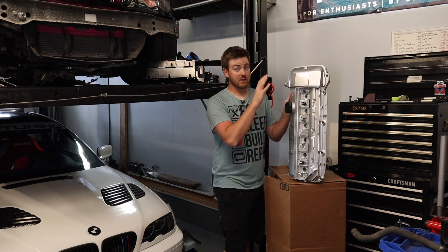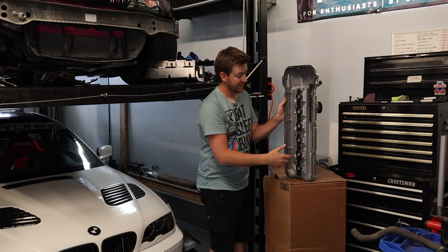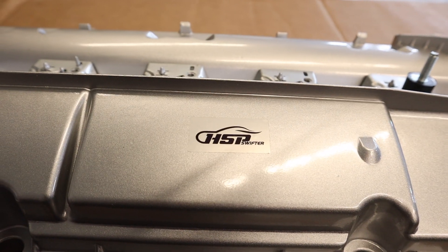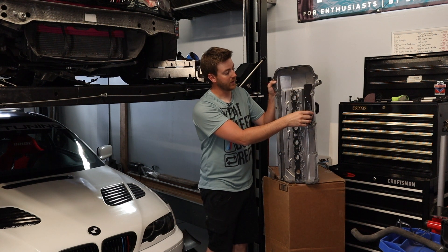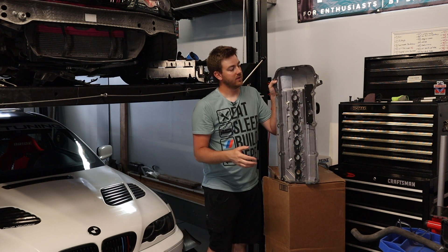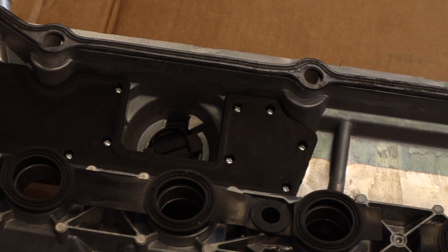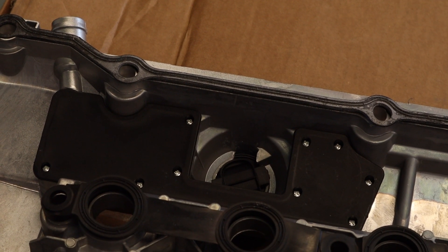For me, as long as it's not being actually physically damaged — like this edge here along the underside — as long as that isn't chipped, cracked, or there's no holes in it, I honestly don't care. The other review I saw said it didn't have any baffling for the CCV system. When I got these in the mail, the first thing I did was make sure they weren't broken. This was literally all that was in it — a rubber gasket around the edge and then this one. I pulled the cover plate off to make sure it wasn't just a sealed box, and it is not. There's a hole over here and then the vent that goes to your CCV over there. So I'm confused about why that review said there wasn't any baffling for the crankcase ventilation system.